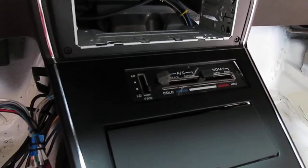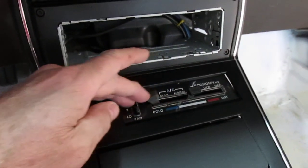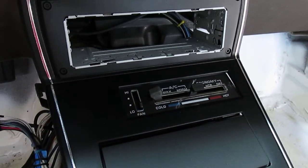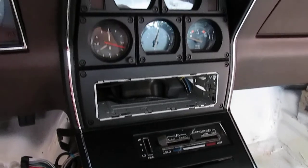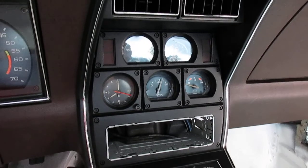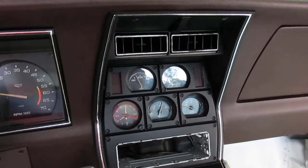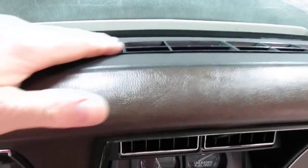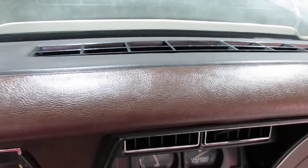Got all of my HVAC stuff working — all of the vacuum lines, the vacuum valve, the fan control, the temp control, all that stuff working. When I change the different selection, the air comes out the right place. Once I got the air coming out the right place, it really has quite a forceful fan, so the AC should work pretty good when and if I ever get to that. I did put in the new defrost vent that just snaps in there — the new one snapped in and didn't fall out like the other one was doing. The other one had a little bit of warpage and was not allowing it to snap in correctly.